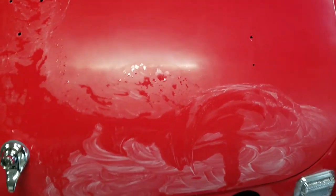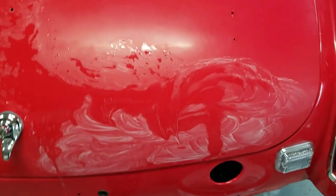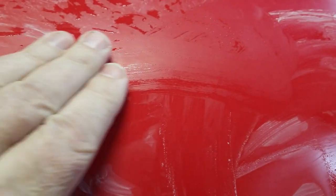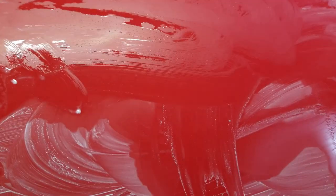The trick with that is that you have to do some wet sanding. What I'm doing is starting with a 2000 grit. The 2000 takes a very small amount of the clear coat down, and what you're trying to do is get it to the point where there's no texture whatsoever on the clear coat.